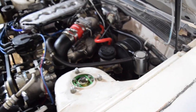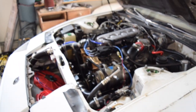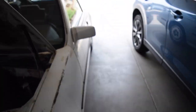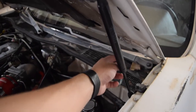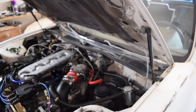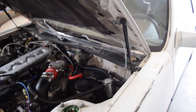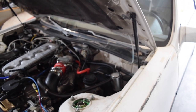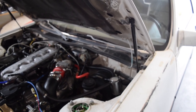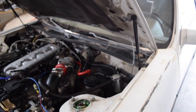Basically what I did is I pulled the pumps off and hooked up some spare wires to my battery right here to see if I could get them to turn on. The one for the front — you can see it connects to this cable right here — it didn't do anything. The motor just stayed silent when I hooked it up to 12 volts. I went ahead and tried forward and backwards to see if it was a polarity issue. It was not.